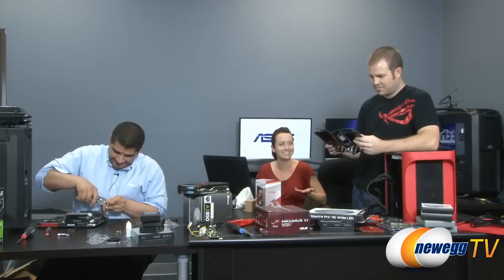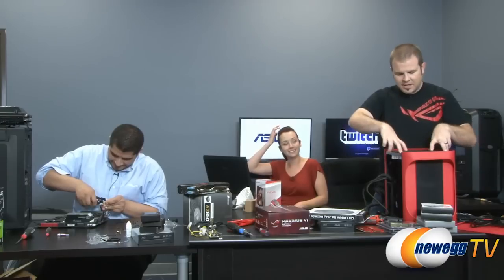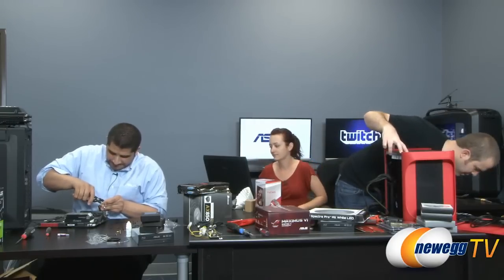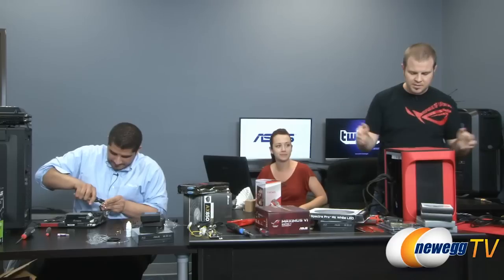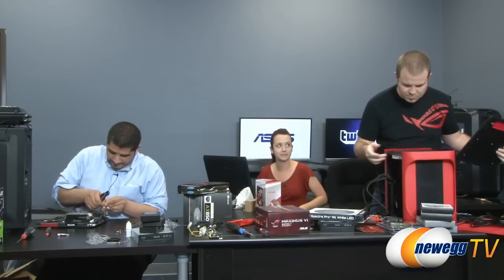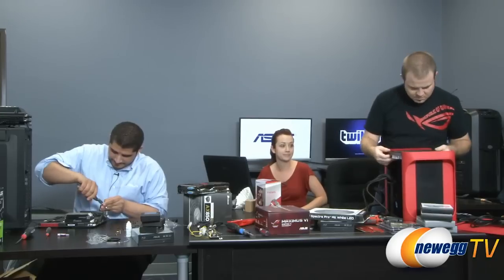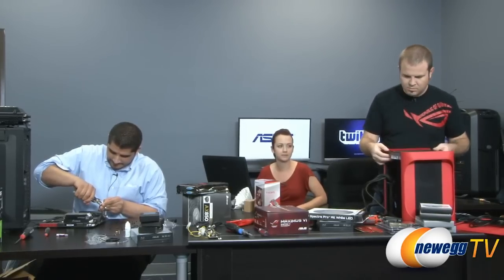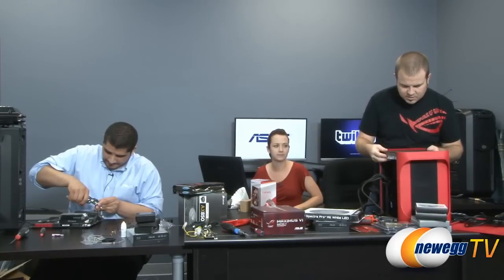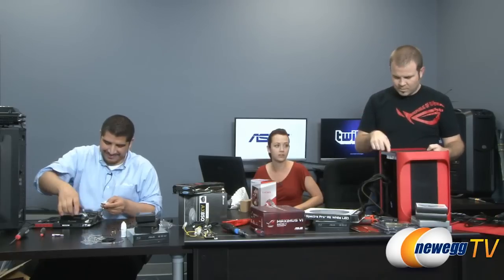What's going on? This fan doesn't want to go in. Do you need me to take things out of boxes for you? No. Here's the thing. It's got catches on here that are for this front panel, right? The front panel needs to be able to go on like this and snap into place. However, this fan, which is substantially wider than a typical fan, seems to be conflicting with those little brackets and possibly preventing me from putting that front panel on after it's installed. Can you mod the front panel? You take the brackets that are interfering off the front panel and snap.